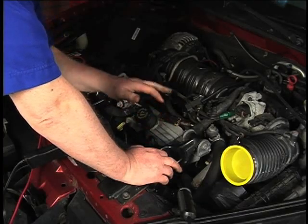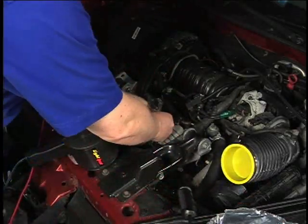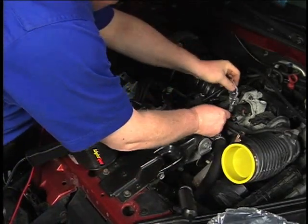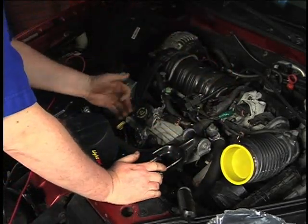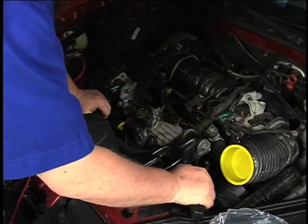Well, I've got a technical tip here. We could just fix one leak or two leaks at a time. We know we're leaking at this intake manifold fitting and we know we're leaking crankcase vapors — we need a new valve cover. But before I send the parts chaser after a couple of parts, maybe we need more parts. Let's get a complete list first. Let's plug up those leaks and see if we leak out any other places that may have been masked because of larger leaks.